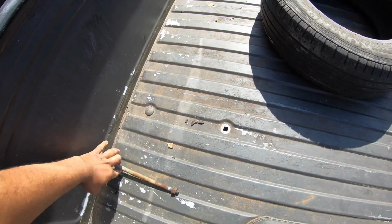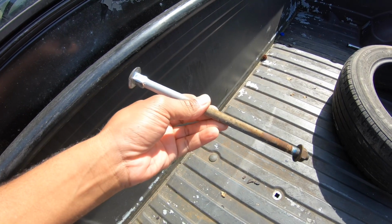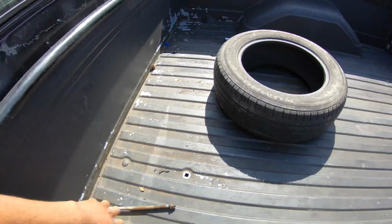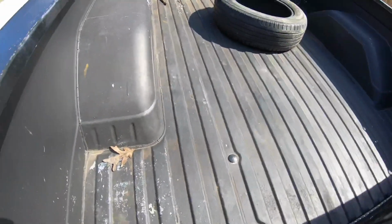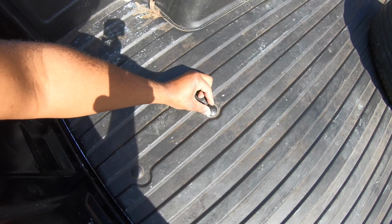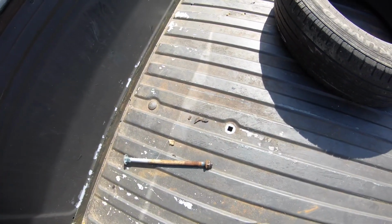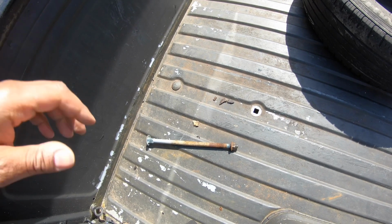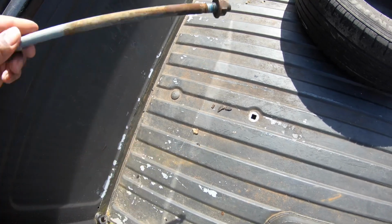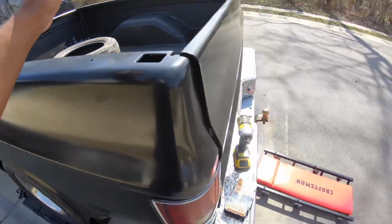So for some reason, I thought this was really simple, just taking these bolts out. But man, these bolts are rusted on there and everything. It is rough getting these bolts out. So far I've gotten out 2. I initially tried to use my 1/2 inch impact to snatch them out, which I thought was gonna be easy. But what I realized is I stripped the sheet metal around it, because I guess it's too powerful. So now I get down there and break each one with the breaker bar, and then I use a 1/2 inch ratchet and just ratchet them off to try to get it off without stripping anymore. I don't think I'm gonna be able to get this one off, so I'm gonna have to lift this one up, go under it and just cut that bolt right off, so I don't have to mess around with this much longer. But I'm kind of tired of messing with the bolts right now, so I said let me take a break.